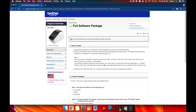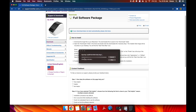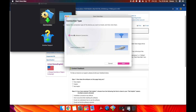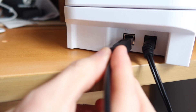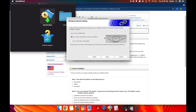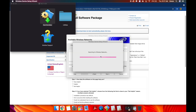We're on macOS 10.14 — hit okay and download the full software package. Agree to the end user license agreement and it will start downloading. Once downloaded, click the DMG, let it verify the file, then double-click 'Start Here Mac' and hit open. When the connection type prompt appears, select 'Wireless' and hit next. The wizard prompts you to temporarily connect your printer via USB cable — plug it into your Mac directly or with a USB-C converter dongle — then hit next, confirm, and hit next again. Now it's searching for wireless networks.